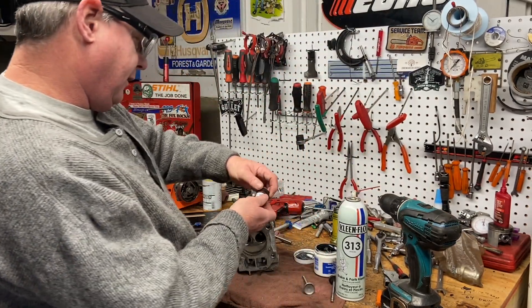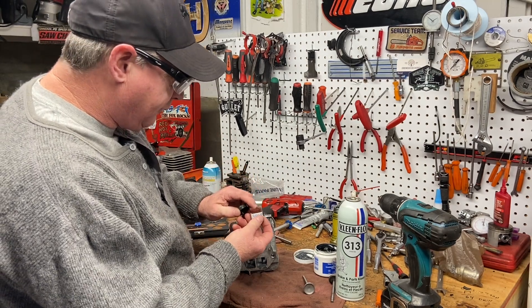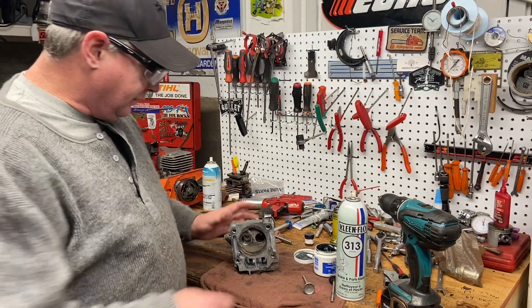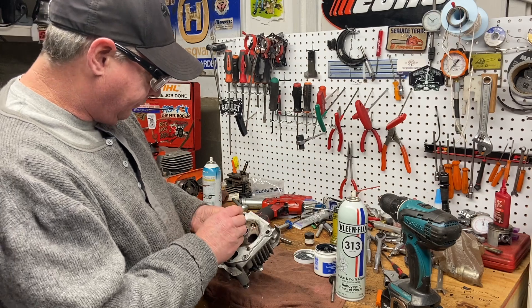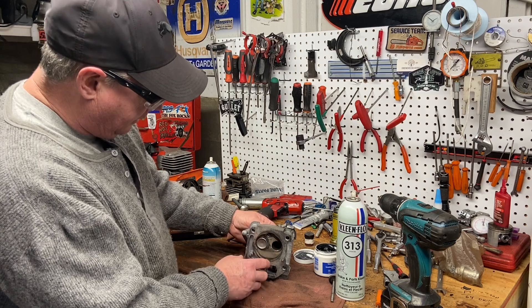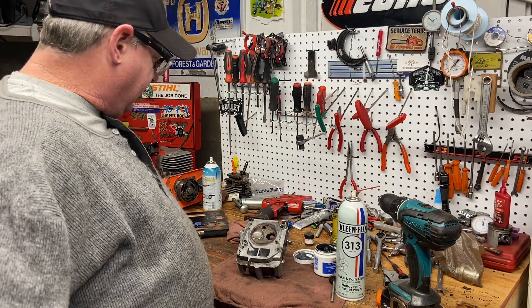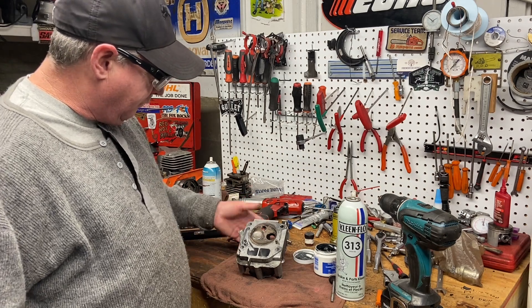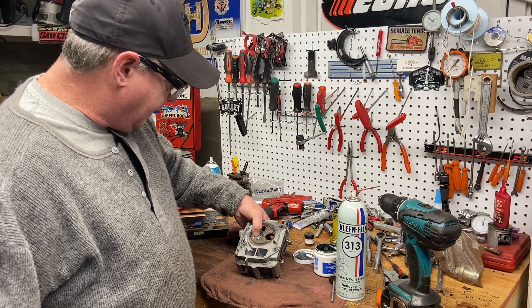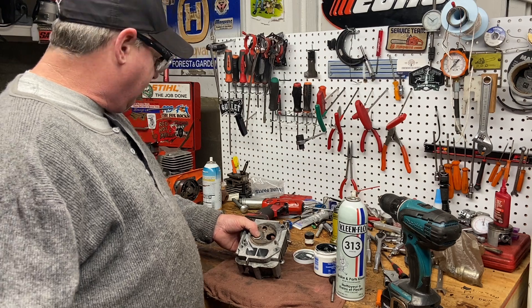It's like a fine polishing compound, so we'll see how that works. Let's get to sealing this valve and see how it laps in, then we'll clean it off, look at the valve and see if it's lapped all the way around decently. Some guys say they don't actually lap their valves — they just cut their seats and put new valves in. Well, that's probably fine, but my buddy Mark Betty always laps them.